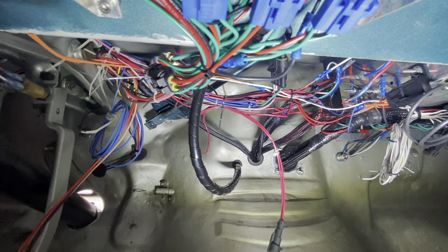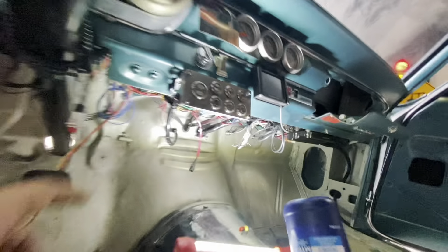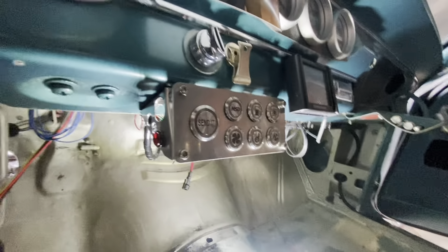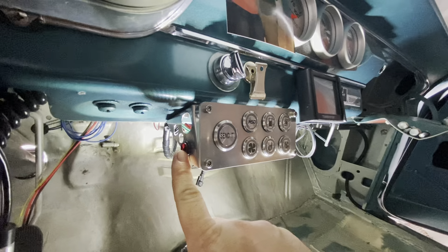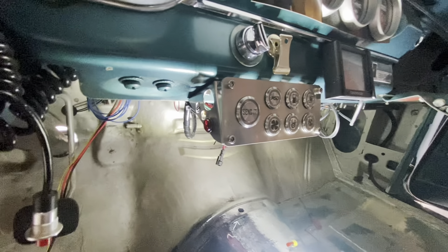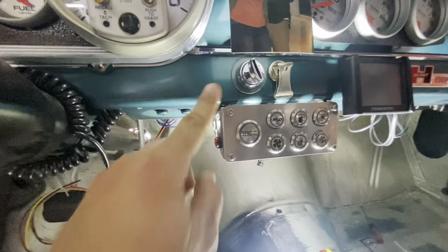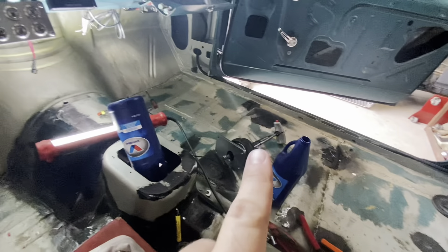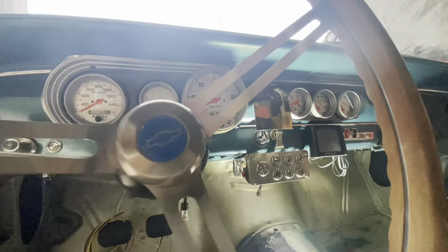All this is a mess from when we wired the car the first time — I never finished it, I just kind of got it running and started driving it, which is evident by a lot of loose stuff we've been finding. It's a bright indicator so you know when your brights are on. This is the line lock indicator — so when you push this button, this lights up to know that the solenoid's powered, and then when you click the button, this activates to let you know that it's actually active. I also mounted this so I'd be able to see the indicators on the ECU, and it's mounted on rubber isolators. I got a sticker to put here with the shift pattern because I'm running the knob with the button instead of the one with the pattern on it.